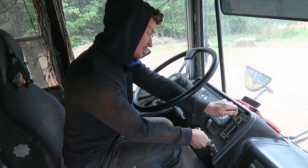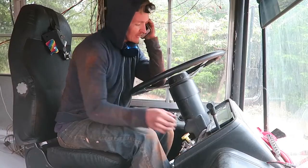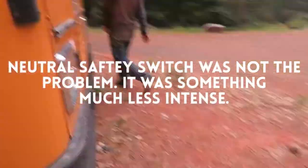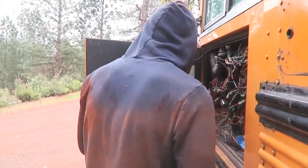I've got the key turned as if I were trying to start it and it's not doing anything. Thanks for your help, Veronica. So what's our plan now? We're looking for the neutral safety switch. It's definitely — well, we can't say definitely yet — not the starter. I really hope you're right, Steve Talbot.